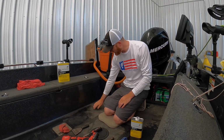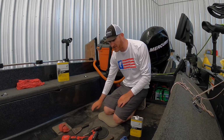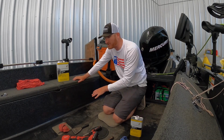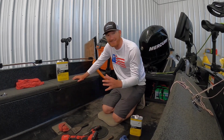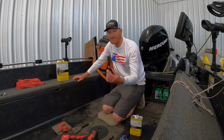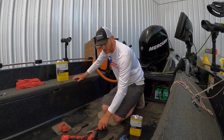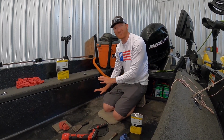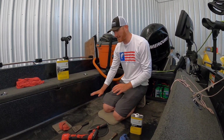But when it's kind of thin like it is right here, there's not a lot there, but we definitely have to get it up. The easiest thing by far was throwing some acetone on it, and in areas that I didn't care about, that we're definitely not going to see when we have the new flooring down, I used an old chisel here, or just different chiseling things, and basically let that sit for just a minute or two, and then I scrape that up.